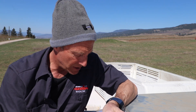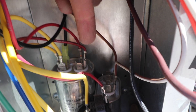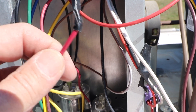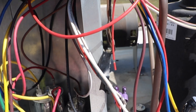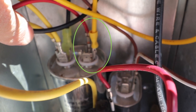Step three: connect the yellow Soft Start wire onto the HERM terminal — you'll see it written H-E-R-M, short for hermetically sealed connection. Our Soft Start kit was a connector short here, but fortunately our RV toolkit had an extra one, so we crimped that onto the yellow wire and connected it in. At the same time, the next step says if you have a second red wire on the run capacitor, pull it off, wrap it, tape it, and drop it — which is what we did. Now our red compressor wire and yellow Soft Start wire are connected on that terminal.